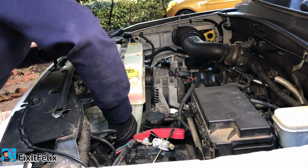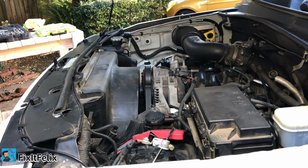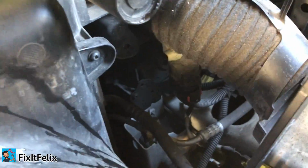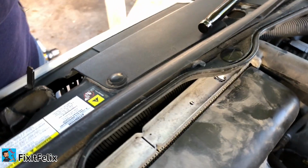Okay, I'm putting my finger. I just took it out and I put it right here near the wall in an angle so the water won't come out. To remove this, all you need is the screwdriver with the same T25, and there's a screw right here, easy to remove, and there's also another one right here on this side, also easy to remove. So I'm going to remove those two right now and show you what's next.